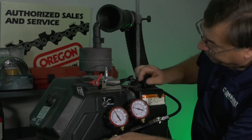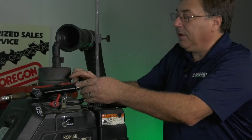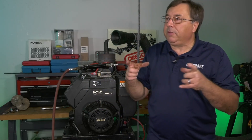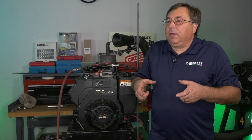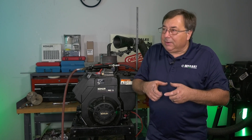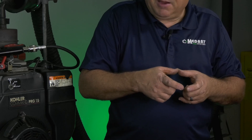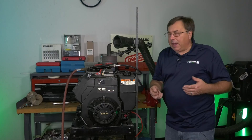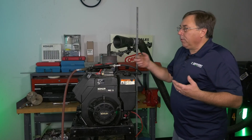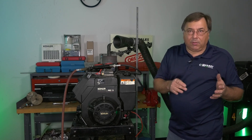Now that's natural — that's going to always happen. The reason it happens is I've got a cold engine where the cylinder rings have not expanded from temperature. As your rings expand, they tighten up because they try to push out on the cylinder walls. As they're pushing out, we have that ring end gap inside the engine — it tightens up. The reason we want a warm engine is you need that ring gap tighter. I don't have this engine to operating temperature, so my readings are naturally lower. When you go to the appropriate repair manual for the engine you're working on, they're going to tell you what is allowable.